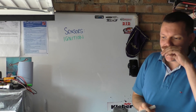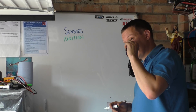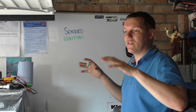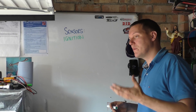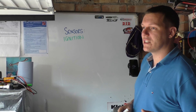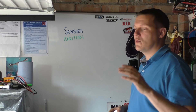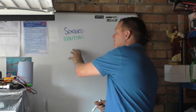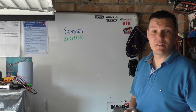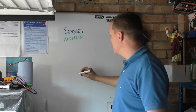We're talking about sensors and in this video I want to talk about ignition. How do you sense ignition? Back in the day they used to have point systems, and point systems were a bit funky — we will go into that. There's more of a need for CDIs and stuff like that because more people have more modern bikes. But I will go through points, condensers and so on. But with electronic engines, you actually need two ways to determine when to have an ignition event.